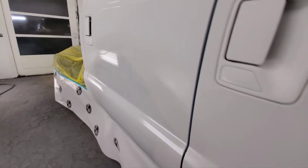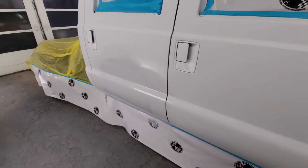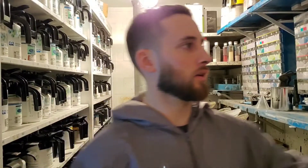You can see how smooth that transition is — that's exactly what we're looking for. We're still going to tack it off before base coat and she should be a nice clean job. So if you blend it out like I do — just pulling away and feathering it out with the trigger — I've had zero issues. You can also use your gun as a blend just because of the way it sprays; it kind of mists up. You'll have like an oval pattern, so when you spray dead on you'll see the top and bottom kind of already fade out. When you do that arc you won't even notice. It's already kind of built into the gun — a lot easier to accomplish the same thing.